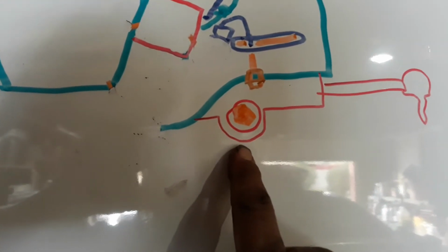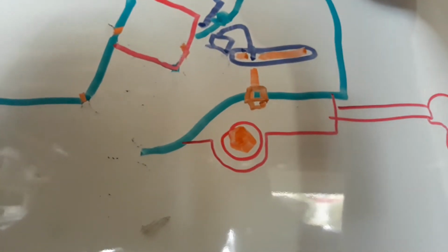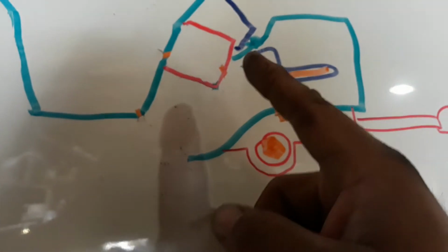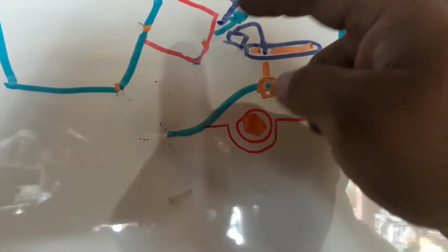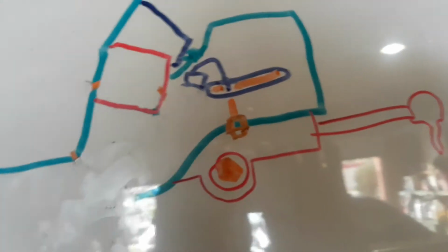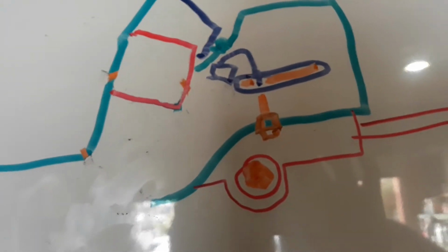So this 22 millimeter bolt has to be broken loose, and that 22 millimeter bolt has to be broken loose. The steering column has to be unplugged from the rack and pinion so that this can drop, and this is going to come through the hole. When it's turned this way, it'll drop right through the frame, no problem. And once the rack and pinion comes down, then I can crack this bolt loose. So there's more to it than just getting the high pressure line off.